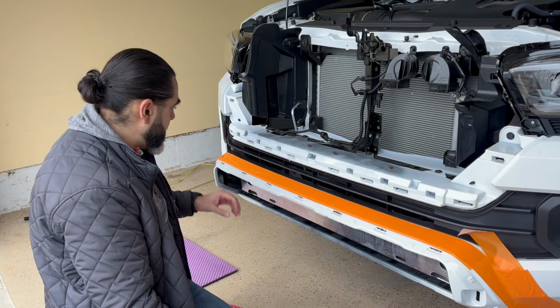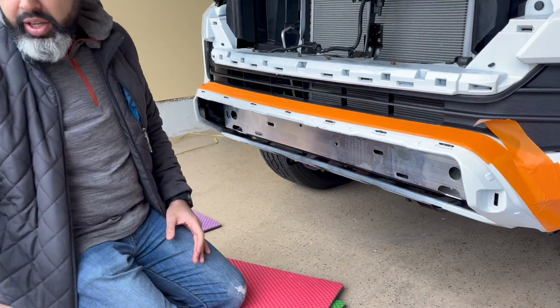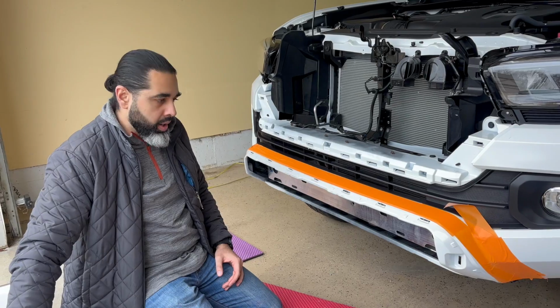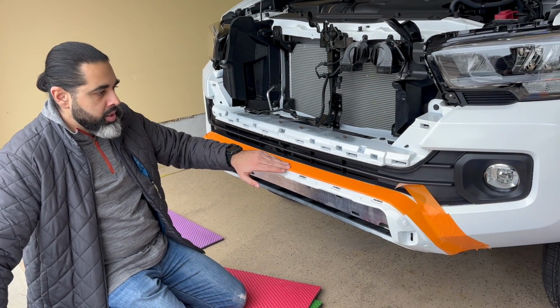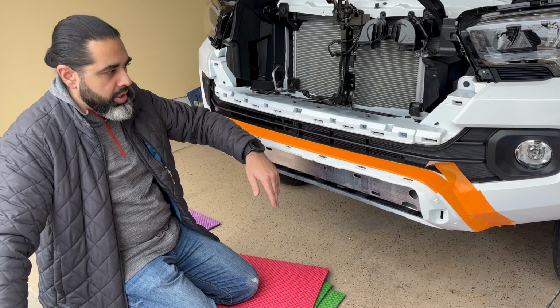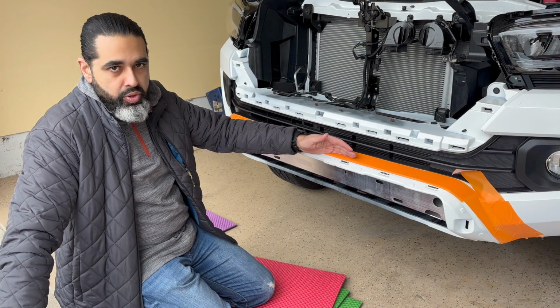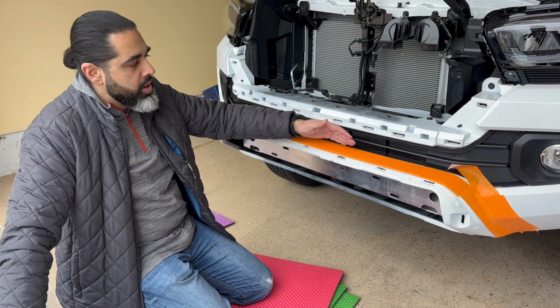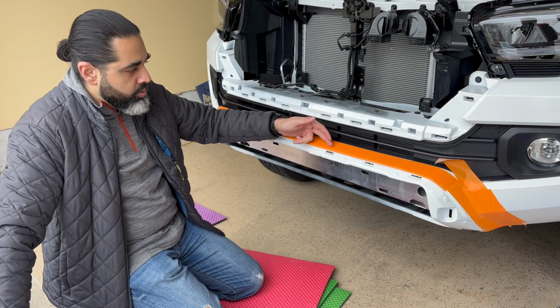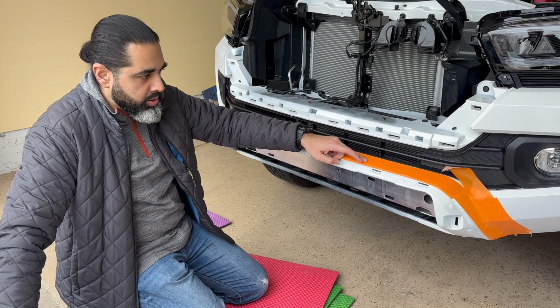This is all plastic. We've got to take it off so the bumper can fit, and then this crash bar can come out as well, so this body armor bumper can go on. Take your time, don't rush. If you're good at cutting, you don't have to tape it. You can put a marker line or imaginary line and cut it. If you have concerns, put a tape, measure 3/4 of an inch or 20 mm, and then make a line as straight as possible.